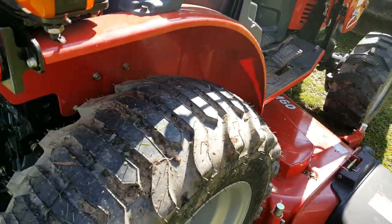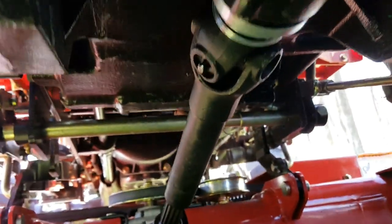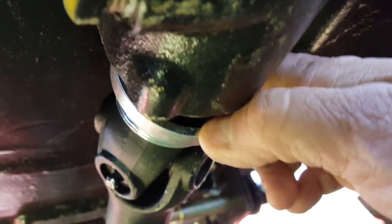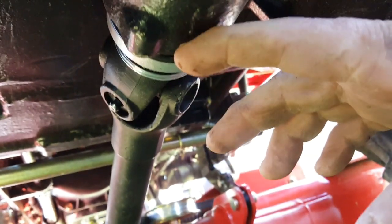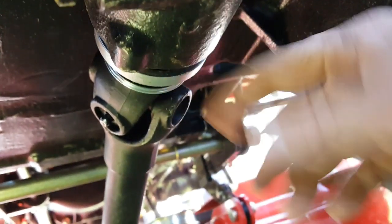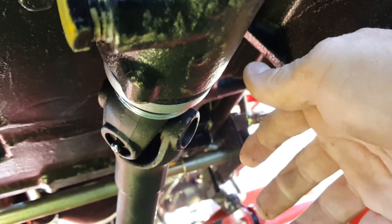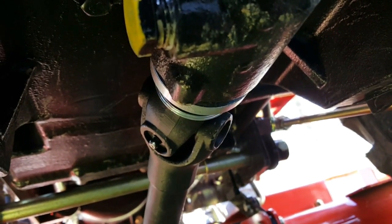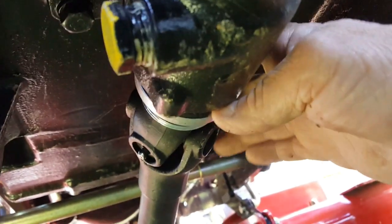The drive shaft is a little tricky. Let's see if I can get down here. You can see the drive shaft - it's got a quick connect on it right here. Let me try not to move it around too much for you. See this ring here? You pull the ring back and you can slide this off. The other thing is you've got to learn how to line the shafts up. Of course, you have to have patience to line these shafts up. And then once you learn how to do that, it gets easier and easier. I've done this about four times so far to figure it out, and now it's getting easier. I can actually put this drive shaft on with one hand.